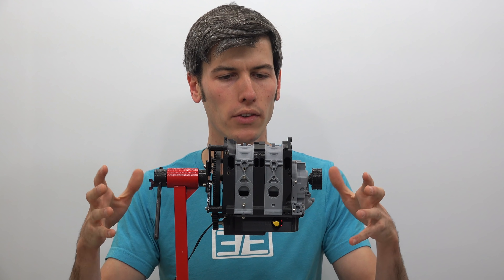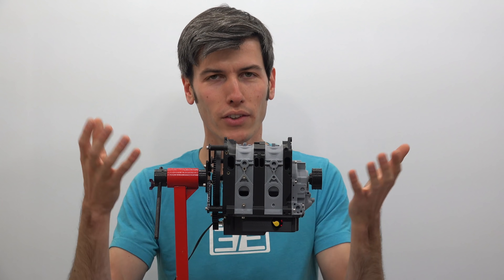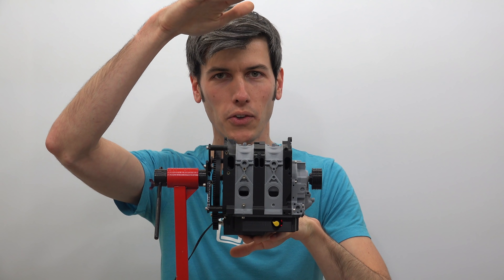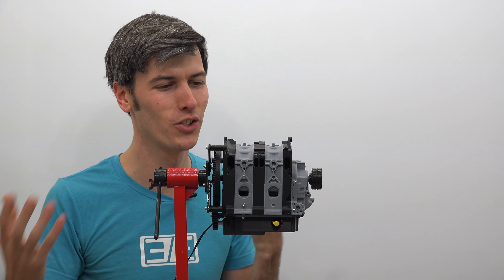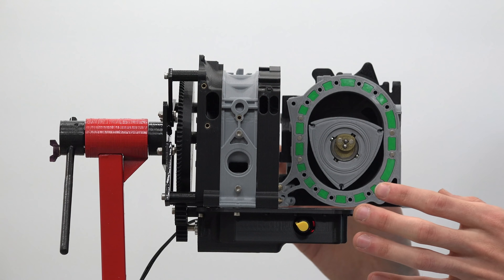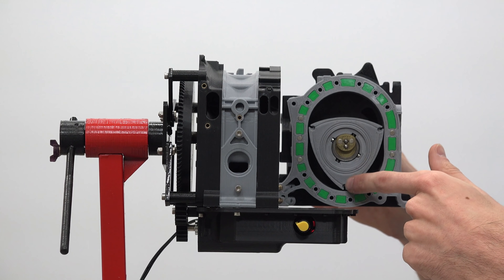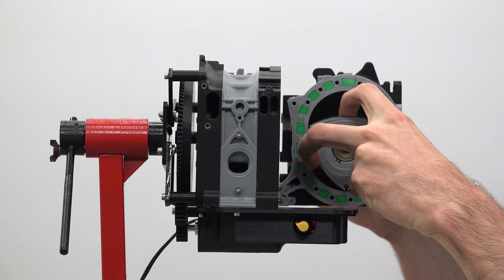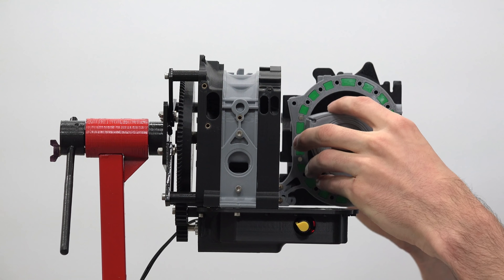Starting with one of the most obvious advantages: this has a great power-to-weight ratio and a great power-to-volume ratio. This is a one-third scale model — imagine it just being about three times as wide and three times as tall. It's about one cubic foot and yet it's capable of producing 255 to 280 horsepower out of a 1.3 liter. Part of why it makes so much power relative to its displacement is that it has a lot of power strokes for every revolution of this rotor. The eccentric shaft is geared to the rotor with a 3-to-1 ratio, so when this rotor rotates just once, the eccentric shaft will rotate three times.